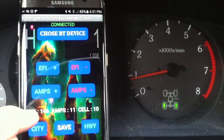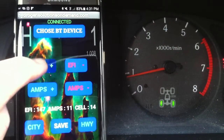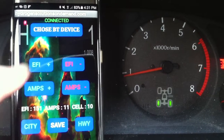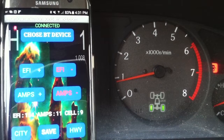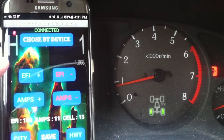Now at 146 — that's too much for this vehicle, should be around 100 or so. The more I increase it, the more fuel I take out. You can see the needle on the RPM start moving because the engine is starving. If I take more and more fuel, it's going to die.